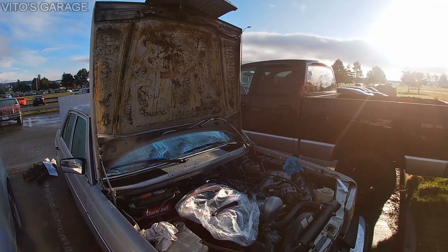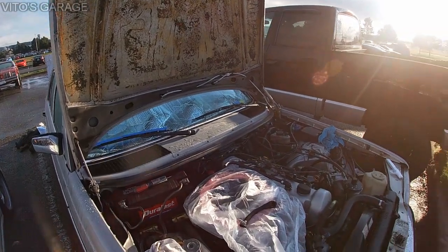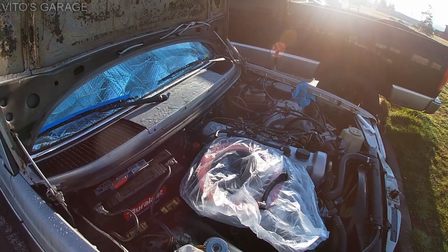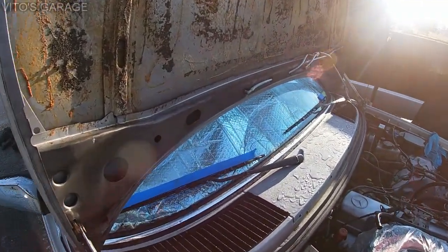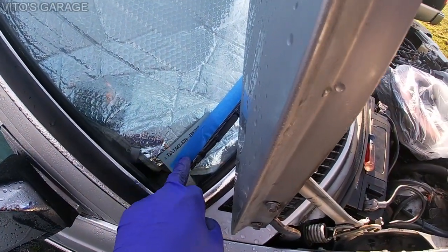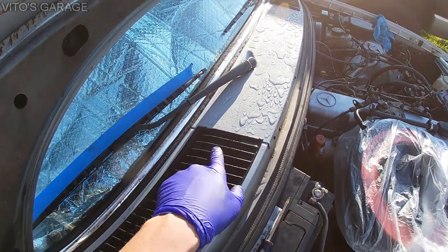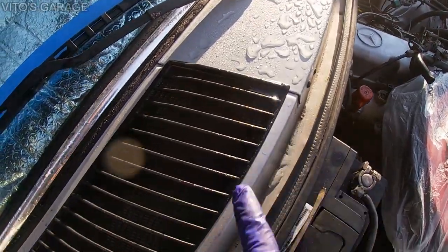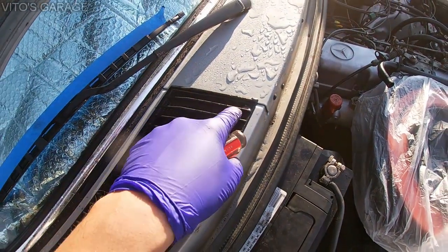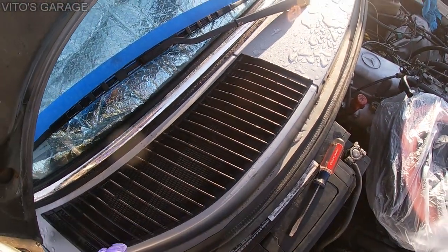The best thing is to lift the hood at a 90-degree angle just like that, so you'll have a lot more space to work with. I have the air cleaner cover covered up because I'm repainting it. As you can see, I have some tape here to give me an idea of how the wiper arms need to go back on. I'm going to start removing these plastic covers — they have four clips. You just push them down carefully, then lift this out and retrieve the center pieces from the clips.